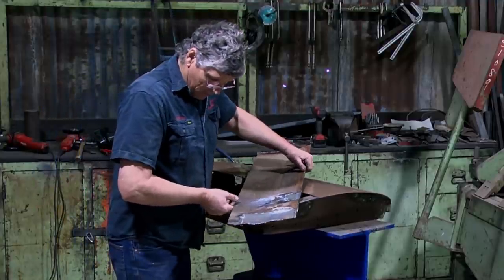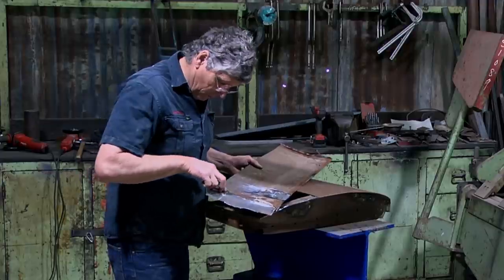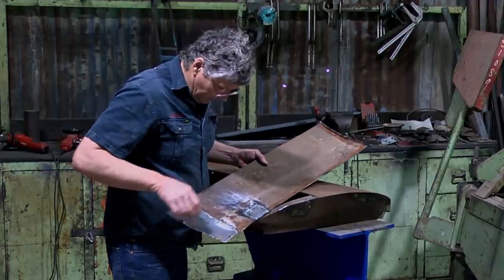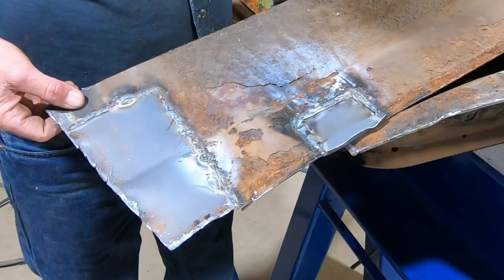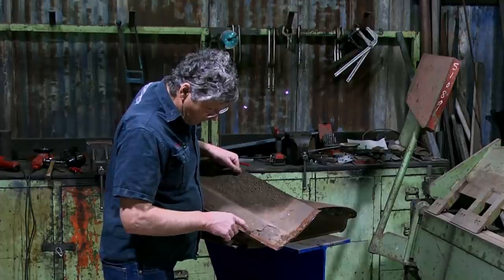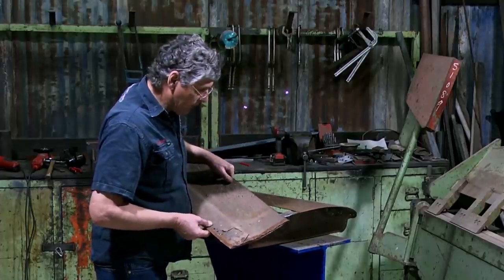If we have a look at the back of our weld, I've got the welder set up well enough that I'm getting a nice burn-through everywhere, so we know we're getting good penetration on it. Even this lap joint over here, we've got good penetration around here and it's built up quite well. We can also see on our skin that we've got a lot of rust in the seam, and it's even flowing up past the point where we've made our new panel to.